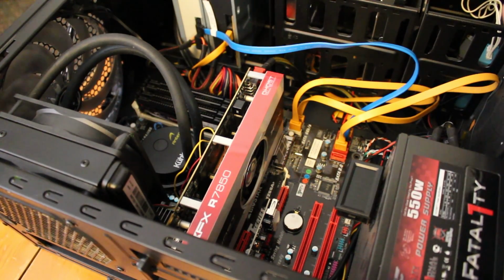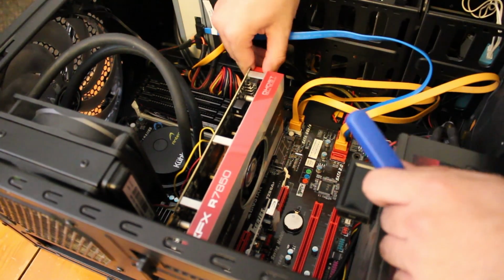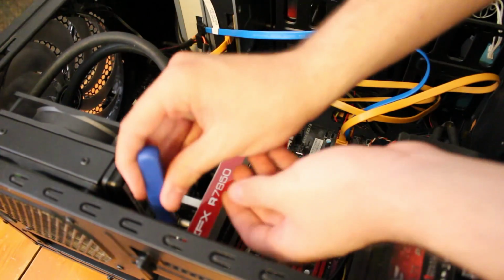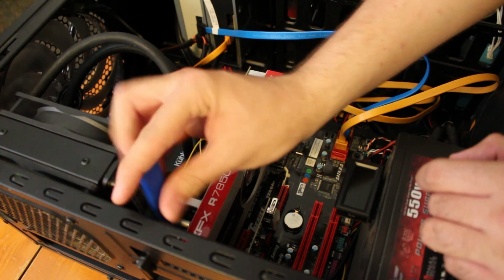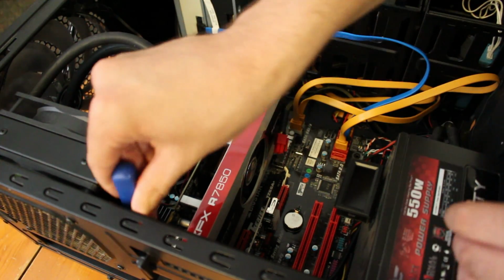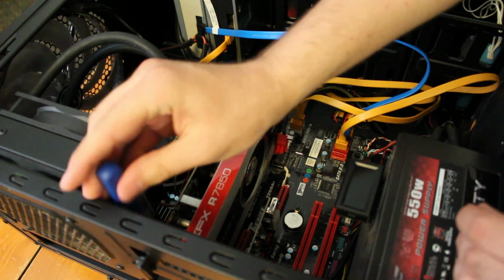Alright, now we're going to do the actual install before I get into that. So, I got my card right here. My computer is turned off. I'm going to go ahead and unplug it, and this is how easy it is to swap cards, you guys, in case anyone on here has never done it, or is afraid of messing with their computer. There's 2 screws, because this takes up 2 big slots, so I'm just pulling out these 2 screws that hold the card in.